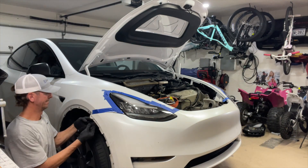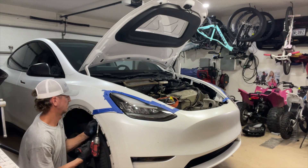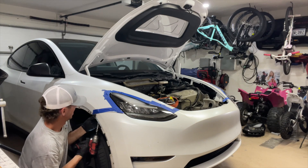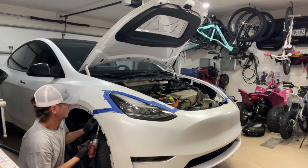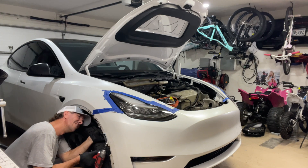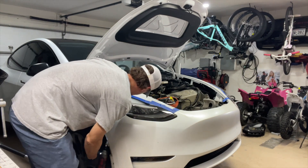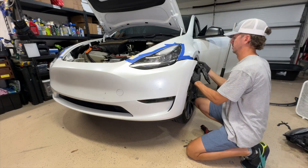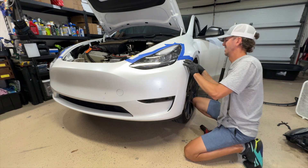Once you get the bumper fully seated, you're going to put your plastic clip in the bumper. I wish I would have just left these in place — next time I will. On the Model 3 there's three bolts, on the Model Y there's only two bolts and none of them go through the bumper. So it's possible to just loosen the two bolts, let the plastic retainer slide down, and then you can just pull the bumper right out. So next time, and for you if you want, just loosen those two — take the one all the way out that holds it into the fender. Out of those three, just remove the one that goes into the bumper from the outside.